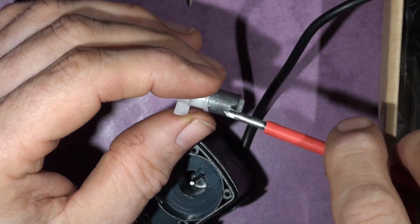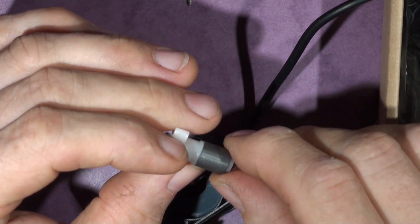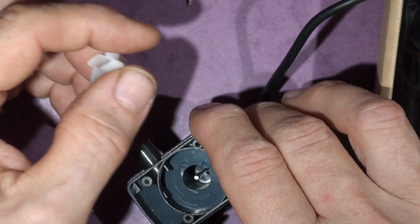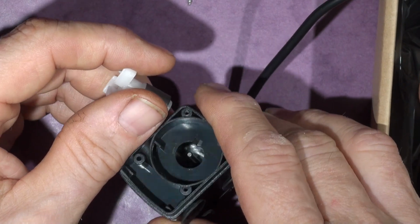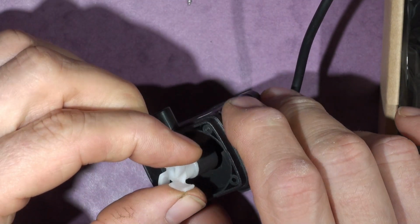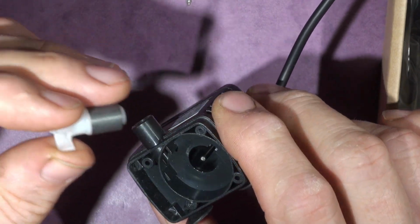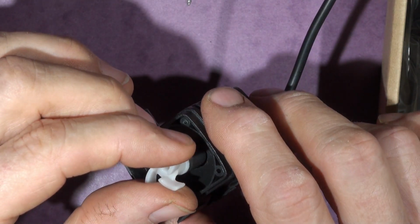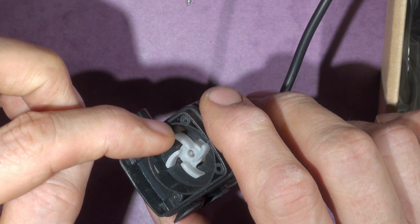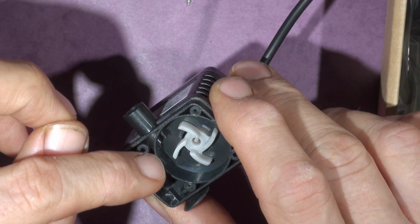Yep, that's magnetized. Two poles on it, I think. Ferrite, so it won't rust, and it's just glued onto the plastic. And then down the centre of there, you can see you've got just the metal shaft. And it's one of those things where the water provides the lubrication. Yeah, makes it nice and spinny. So it spins around in presumably that direction. You'd think it would go that way, wouldn't you, the way those vanes are designed? Have they done that wrong?